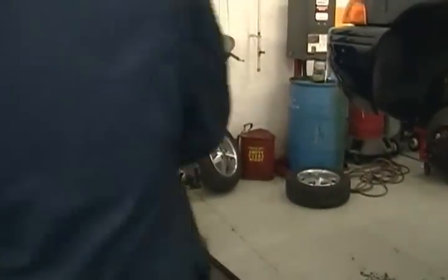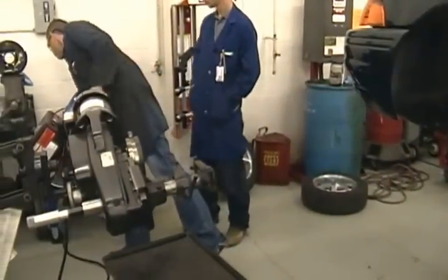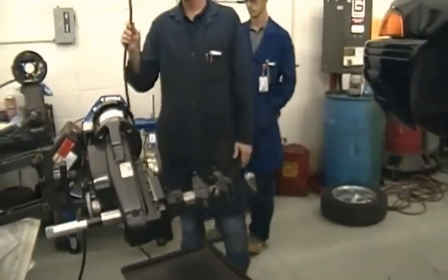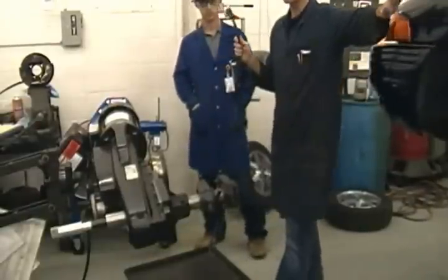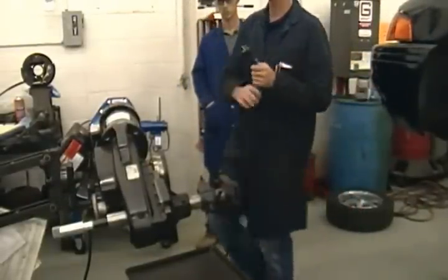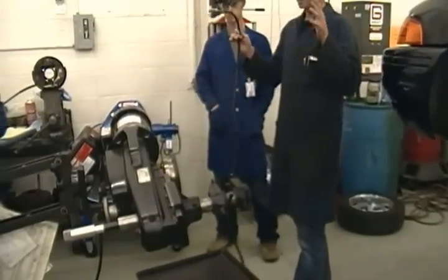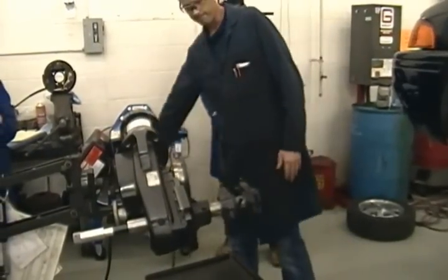Now we're going to get ready to connect the machine to the car. Always make sure it is unplugged until you're done with all the connections and you're just ready for the controls. That way we ain't got to worry about somebody coming in, bumping the on switch, turning it on, anybody getting hurt. Just leave it unplugged until everything's connected, okay?